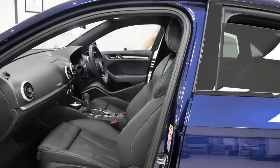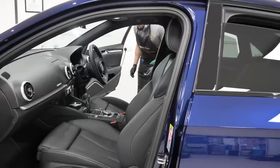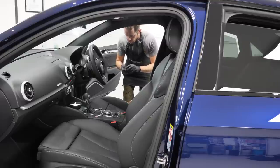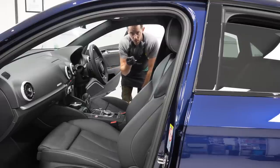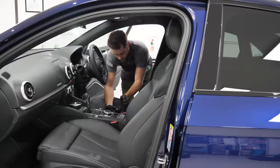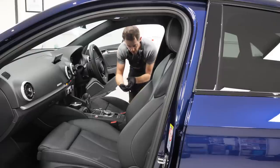So, by the way, all of the windows dropped then because I did it off the key fob. If you press and hold unlock, the windows will lower. Press and hold lock, the windows should raise. The doors. It does work. Not every car has that though. So of course, if it doesn't work, ignition on, you have to do it manually.